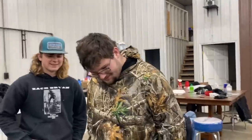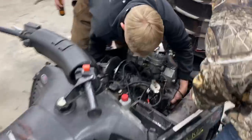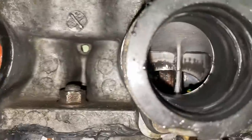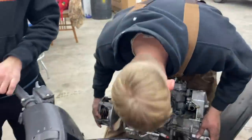What? That's my oil injection line. That thing don't inject. Well, maybe that's why it blew up. Oh, come on, yeah. This is the bottom of that piston. It's like a rainbow. And that one's like a bridge that's straight. Bridge, rainbow. You want a bridge flat.